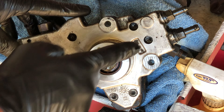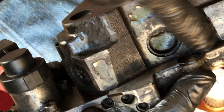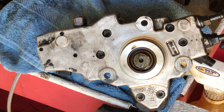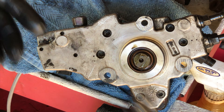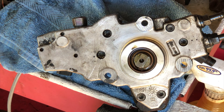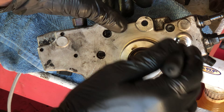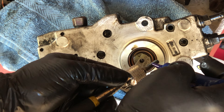Now we've got six bolts that come loose. The trouble with this pump is it's leaking fuel all along here, spraying out and getting all along the side of the engine — the notorious six bolt fix. One, two, three, four, five, six. We're going to take each one out one at a time. A magnet is handy because they don't come out far enough on their own — it's a captive bolt. They are magnetic though, so they come right out. Just put a little dot of Loctite on each one.